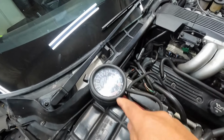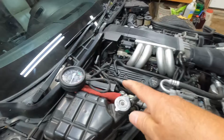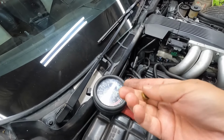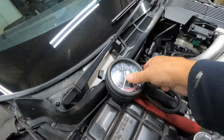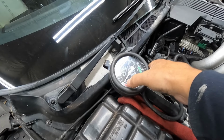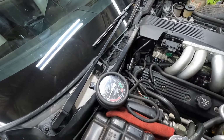And then you would just start it. I'm not going to go into this, start it up. You won't be able to hear anything with the motor running anyway. But a stock motor without using any of this, that's in good shape, you should have 2 to 3 inches. And you'll see the gauge. In the case of this gauge here, it'll just barely move to hit that white line. That's all it has to move.